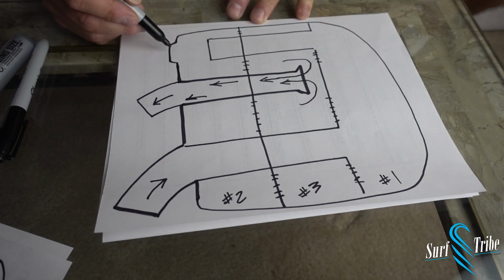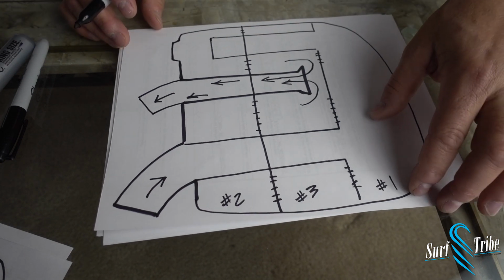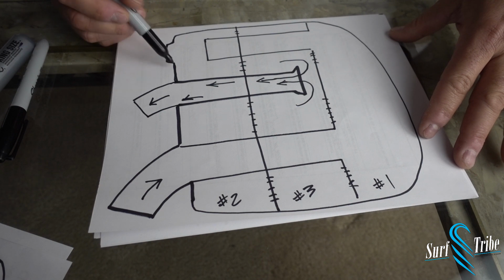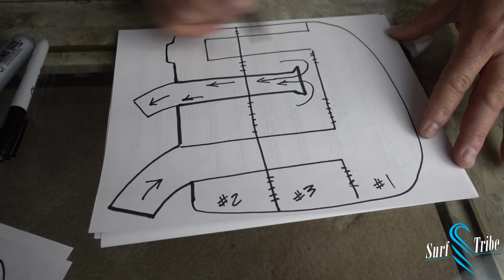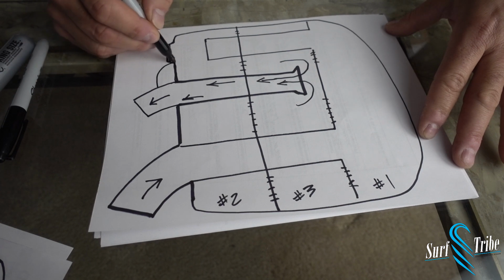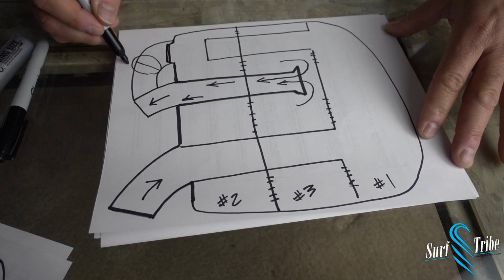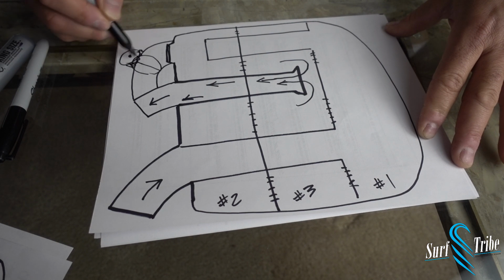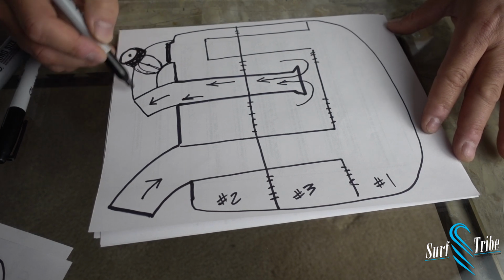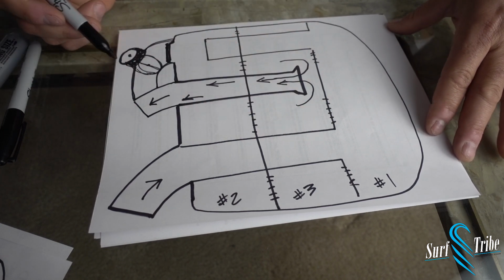This is where Porsche pre-designed the muffler for some of the other models, I believe like the Cup cars and some of the later models. They engineered the muffler basically for the future. Instead of leaving it like this, on the other ones this is cut off, and a pipe is welded onto here that connects here to here, and it has a valve in it, like this. So that's what Porsche does. On some of the later models, they weld the tube on here, and it allows the exhaust to flow straight through and then straight out here when you open up the valve.